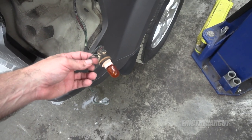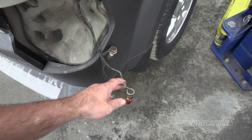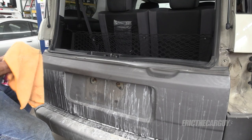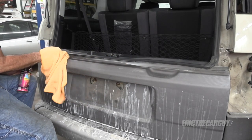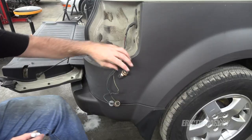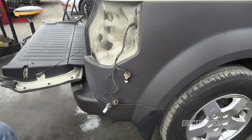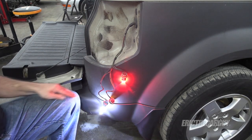That transition does work — that color match is pretty darn close. I'm happy. I think it turned out rather well and the color transition is not that bad; it's not very noticeable at all. It looks way better than that rusty stuff that was dripping down before. Now let's get it all back together with new LEDs. I'm not doing the turn signals because that way I'd have to install either a new flasher element or a resistor. So I'll just leave those like they are, but the reverse lights and brake lights are getting swapped for LEDs. The running light slash brake light gets a red one, and the reverse light gets a white one. Let's just check those — nice. Oh yeah, we're good.